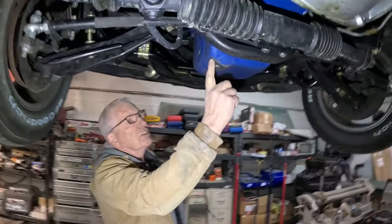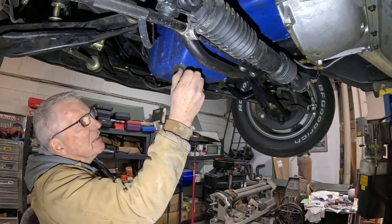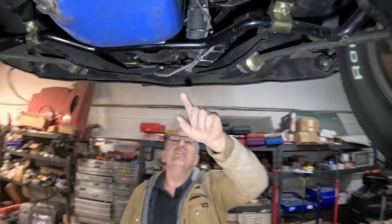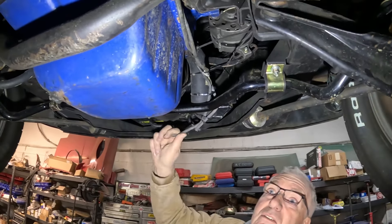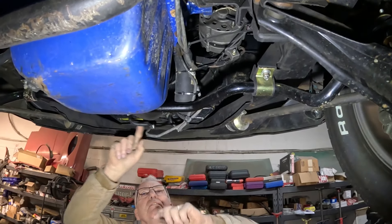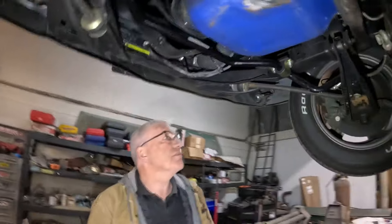This is a nice touch — I'm guessing we had a stripped oil pan plug or a badly leaking one, but they've just drowned it in what I think is RTV or similar sealant. That's something we've got to fix. These transmission cooler lines are also not routed well — there are lots of cable ties holding them, tied to the radiator hose. They're touching hard into the sway bar, and you've got a very tight bend in the hose here that's almost kinking it off — that one is actually kinking. So yeah, there are things that need to be done.